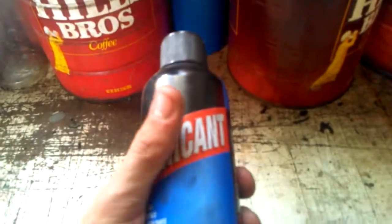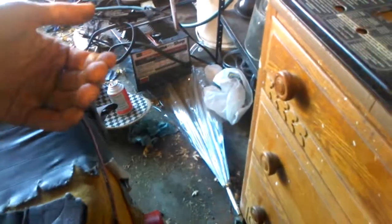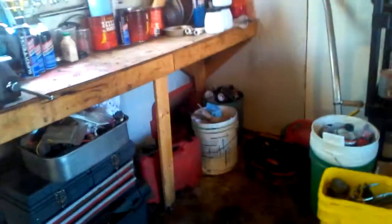A little bit of spray lube goes a long way in some situations. Then you have your grease — the more solid form of lube. For things like kickstarters on these scooters, I did one recently where it was all gunked up and dirty — you'd push it down and it just wouldn't come back up. You'd have to push it back up with your foot. Just pop the cover open, spray it out with carb cleaner, wipe it down with towels, put some grease on it, and it'll work like new.